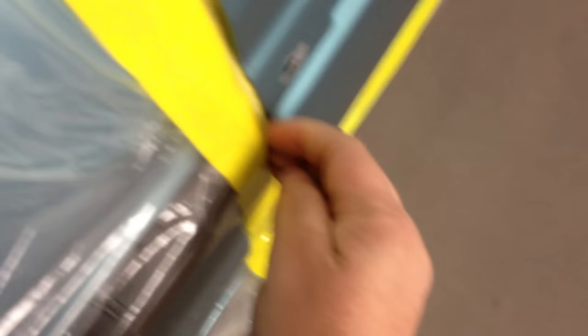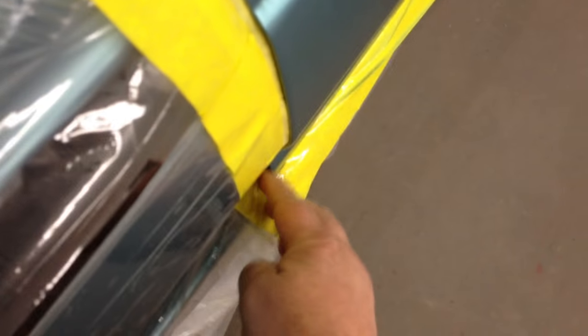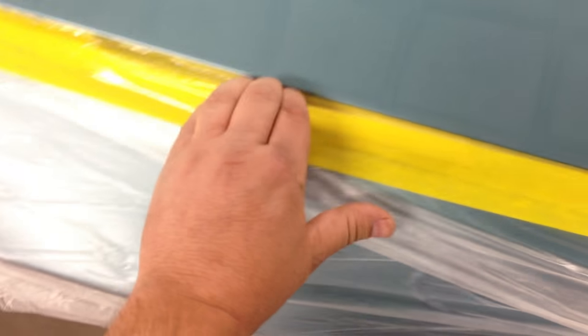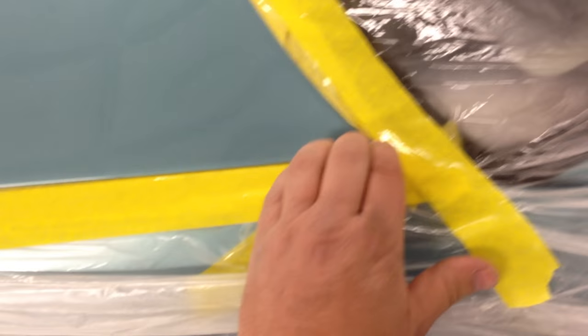With this masking, it's very important — if you notice how I've been going around pushing back on the mask, just pushing it back away from the panel. This will eliminate any problems you may have, especially if the clear coat kind of bridged to the tape. If you pull forward, that might pull a chunk of clear with it, so always just push that tape back down. That makes a real nice mask job — you can't really notice that it's even been painted there. Just be careful with that — don't pull forward on that masking tape.